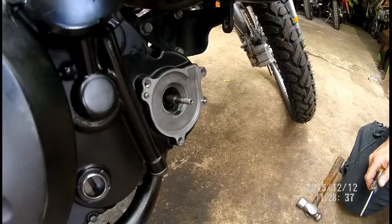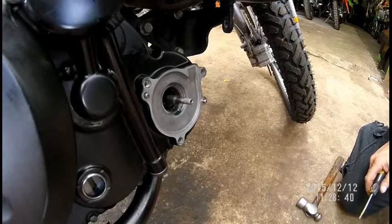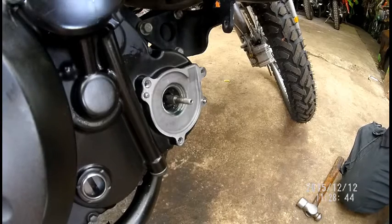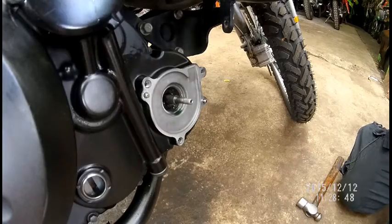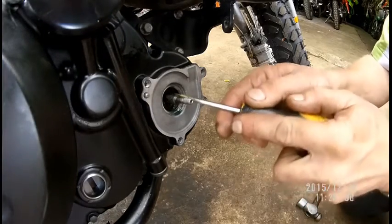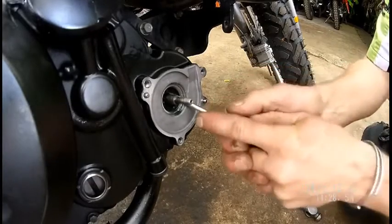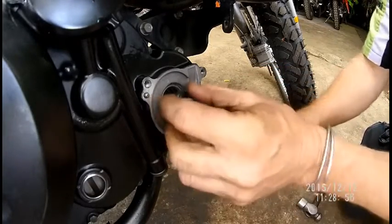That's fine. Now this whole thing is part of it, Claudia. When you buy the water pump mechanical seal, that's the whole unit. And that's supposed to be glued in there so it seals, okay? The factory one comes already glued, but I rip it out. Now that's my oil seal. All the time, I don't want to damage the shaft, okay? Looks like the oil seal's condition is fine. No, because I've actually punched it, you see?